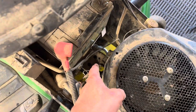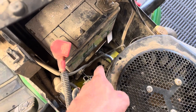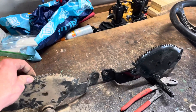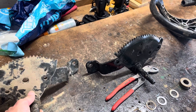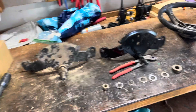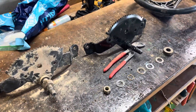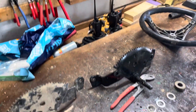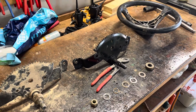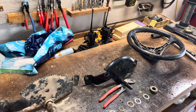You can see all of this just by looking right down here — just lift up the hood and inspect there. As you turn the wheel back and forth, you'll probably be able to see your problem. And I don't know if it's supposed to be lubricated as part of regular maintenance, but if you own one of these and it's happened to you, or if you own one and you don't want it to happen, I would suggest lubricating it with a really heavy lithium grease.